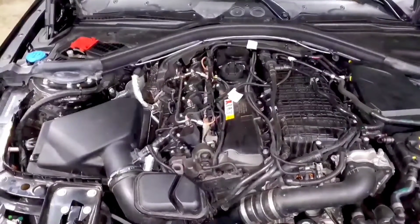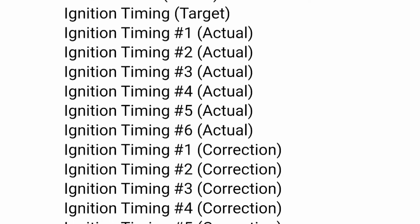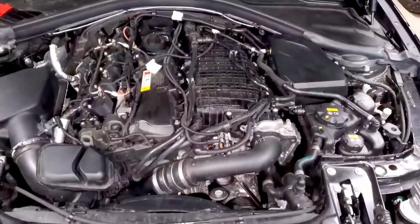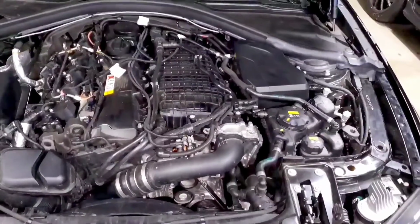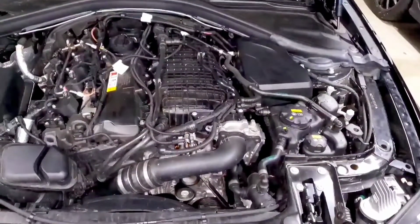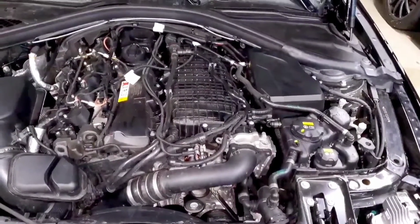I'll put a list of the parameters that I suggest including in the description. Not all logging software will have all of the parameters, and some logging parameters will be named differently depending on the tuner that you're using. But just look for something that matches that description and make sure that you have those included as a bare minimum. There are a lot of options available, especially again on later model cars that have the additional RAM channels and things like that. But again, the more data that you try to collect at once, the less discrete the data will be as you're going through the pull. So like I said, if you have 20 data points selected instead of 10, you'll have half as much data throughout the pull.